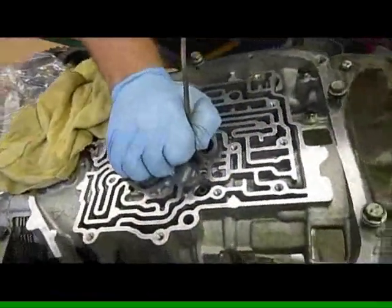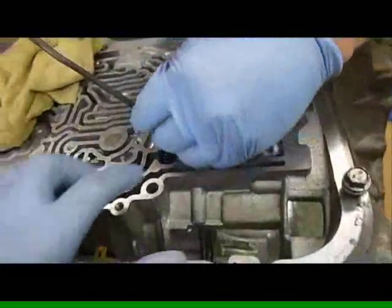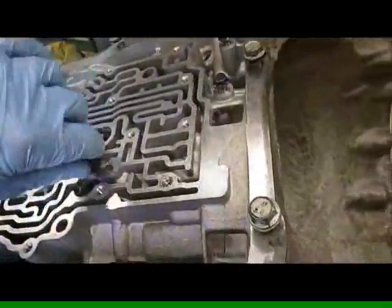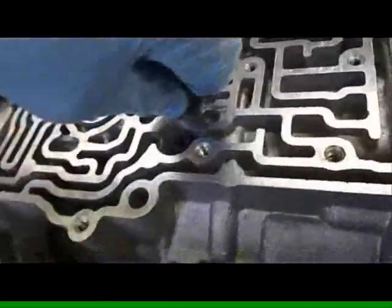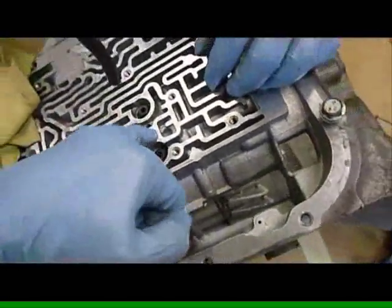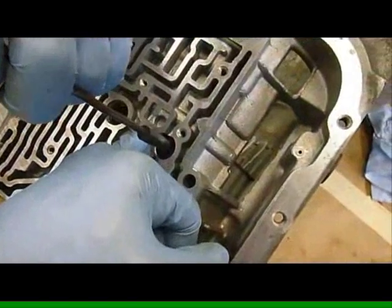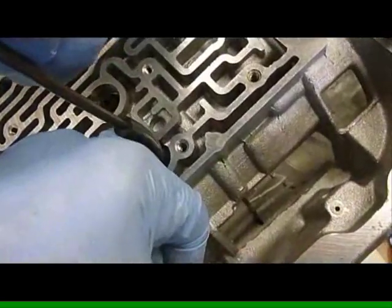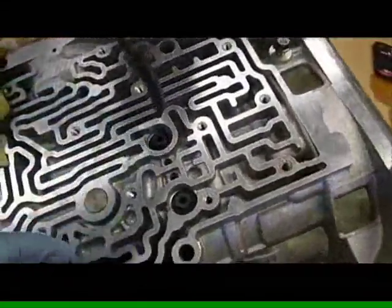Pressure checks: we've just tested the forward clutch, and now we're going to test our reverse high. Away we go — that works. Now we'll try our drive section, and it's working — going back and forth, on and off. We'll check our overdrive afterwards once we get that on. It goes up to that piston and cylinder in there, which will engage the overdrive clutch.